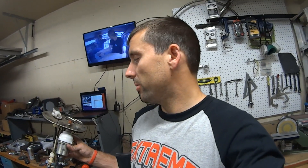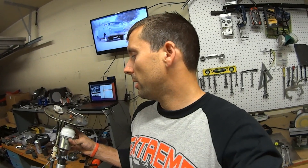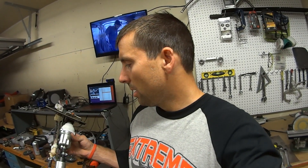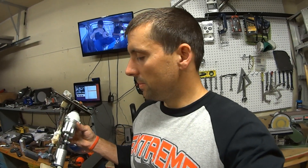My chassis did not have a return, so I actually had to run a return line, which I will show you some footage of right now. Once I ran that fuel line basically from the engine bay back to this, having this whole housing here which I just got off eBay from a wrecker yard allows me to run a return style fuel system, and that just makes it a little bit easier on me. Now I am just going to drop it back in the car, and then we will enjoy skids afterwards hopefully.